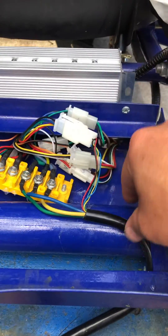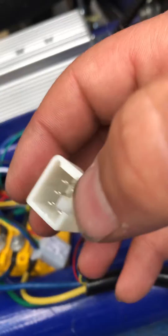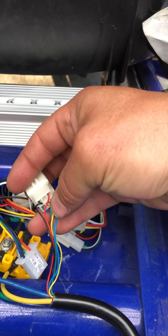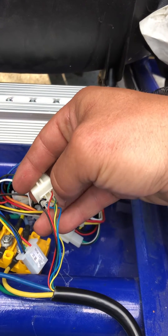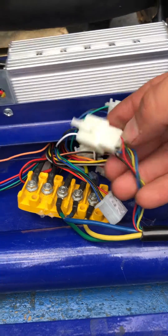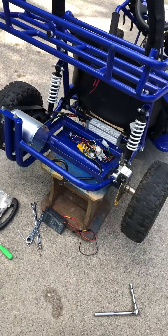So I also had to adjust this five-pin connector, which is connected to the motor. If you look in there on the right side through that little clip, you take something like a tiny screwdriver or one of these dental picks and just push in on that little clip, then you can slide the clip out. What you need to do is take the green and yellow pins and swap them. So now here blue goes to yellow, yellow goes to blue, and then you just take the green and swap it with the yellow, plug it back in, and it works like a champ. That's how you switch the polarity on a 48-volt brushless motor.